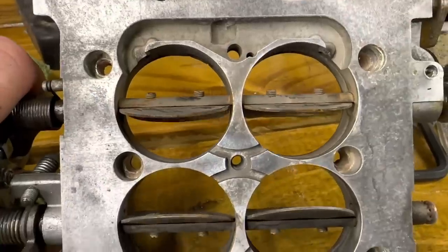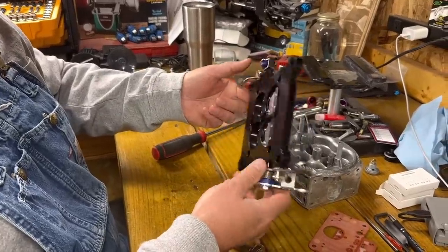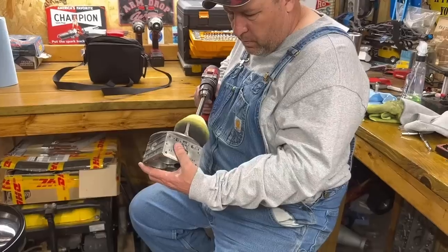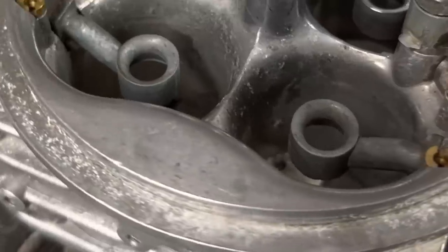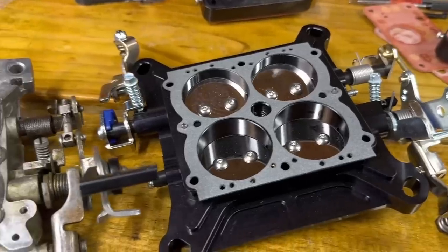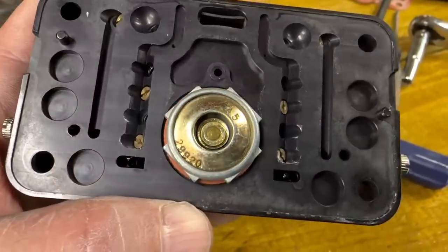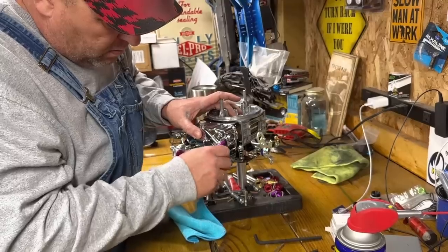It's always been a really good carburetor until recently when Tony and Tess experienced a couple little mishaps with a nitrous kit. A leaking nitrous solenoid caused a little bit of an explosion and bent the throttle blades while we were down in New Orleans. So I'm replacing the stock cast base plate with a new billet aluminum unit from ATM. While I've got the carburetor apart, I want to try some of this JAX wax metal polish and polish up the main body, which has gotten corroded terribly from the humid saltwater air near the coast. The JAX wax metal polish brought it back good as new. I transferred the main body onto the new billet base plate and checked the jetting — the 4.5 power valve was a little too low, so I switched it up to an 8.5 and put the jetting back the way I had it when I originally built this carburetor.